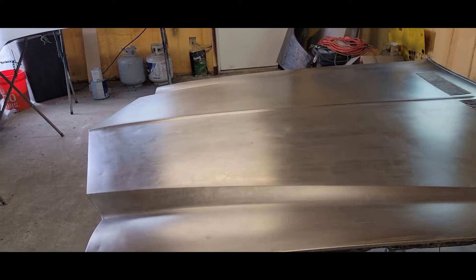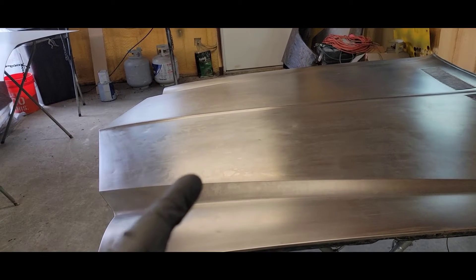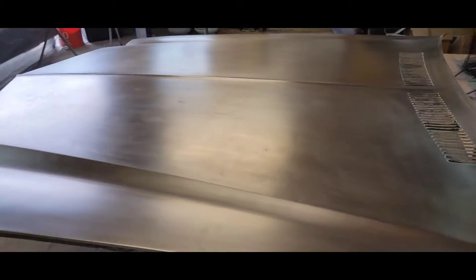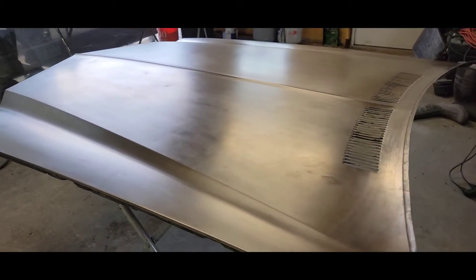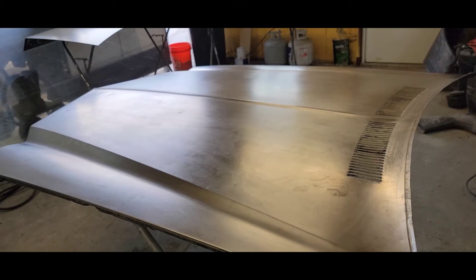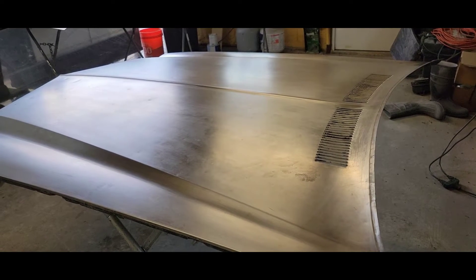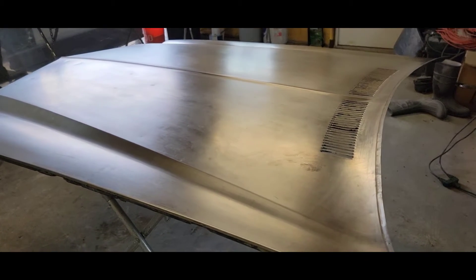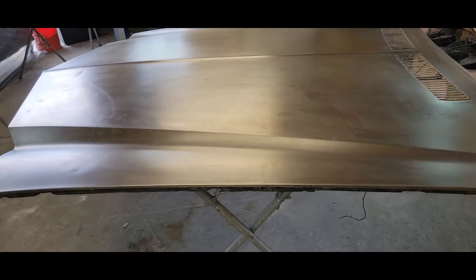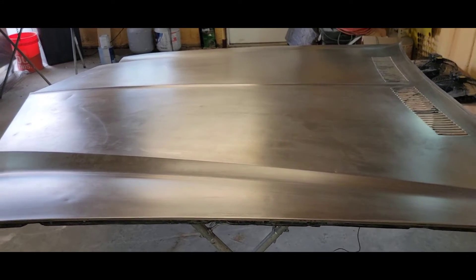I did a second coat with the naval jelly because the first coat didn't really clean it off the way I wanted it — it left a few spots here and there. So we did get a second coat done. One night late after I got out of work, got that done and situated, cleaned up, blew it all off with air, and wiped it down. She got really nice and clean. So we're gonna go ahead and hit it with the 80 and then get two good coats of Epoxy Primer on it.